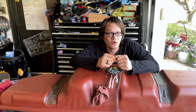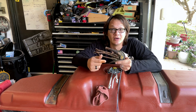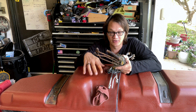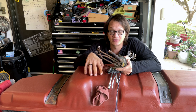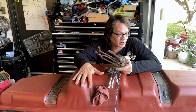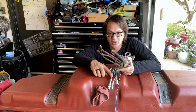After sitting in the woods for however long it's been, the fuel pickup got pretty rusty and all these lines are pretty nasty. We initially just pulled the fuel tank out to inspect it, make sure everything was clean and not rusty inside. Turns out the tank is in really, really good shape inside - it's nice and clean. So we went ahead and cleaned up the outside, slapped on some Eastwood rust preventative paint, but the sending unit is toast, so we ordered a new one.